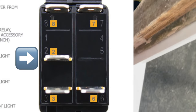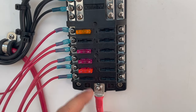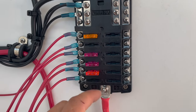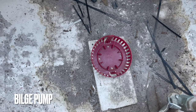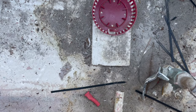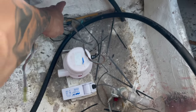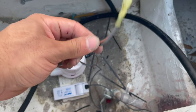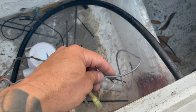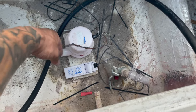Let's tighten up these wires. I forgot to mention — for what fuse to use, whatever instrument you're using, whether it's a nav light or a bilge pump, you have to look at the manufacturer's recommendation for a fuse. Now for the moment of truth — let's see. Now we're going to install the bilge pump. Here's the base; we'll put the switch right in front of it. This is how I'm going to wire it: you have the switch, one wire from the switch splices with the power wire from the bilge pump, and the other wire goes straight to the battery with a fuse. That way when the water level goes up it'll engage the bilge pump.